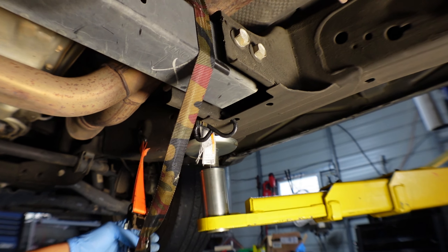See the filter here — we're just going to pull that down. This is pretty easy. Pull it slowly — there's a little gasket there. If it doesn't come out with the filter, just leave it there. So that's out. The filter still has fluid inside, so I'm going to drain it into the drain pan.